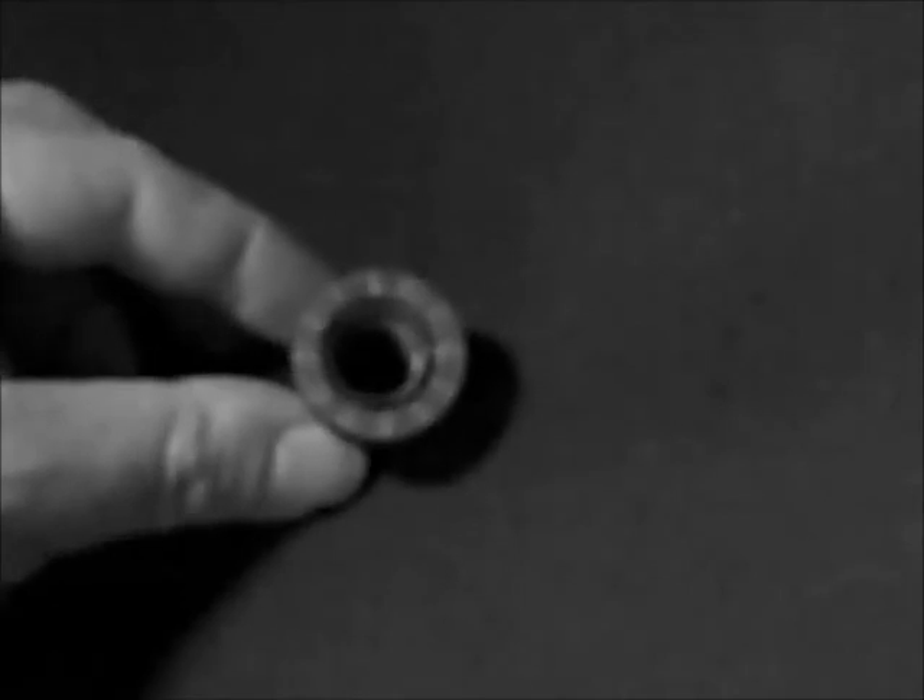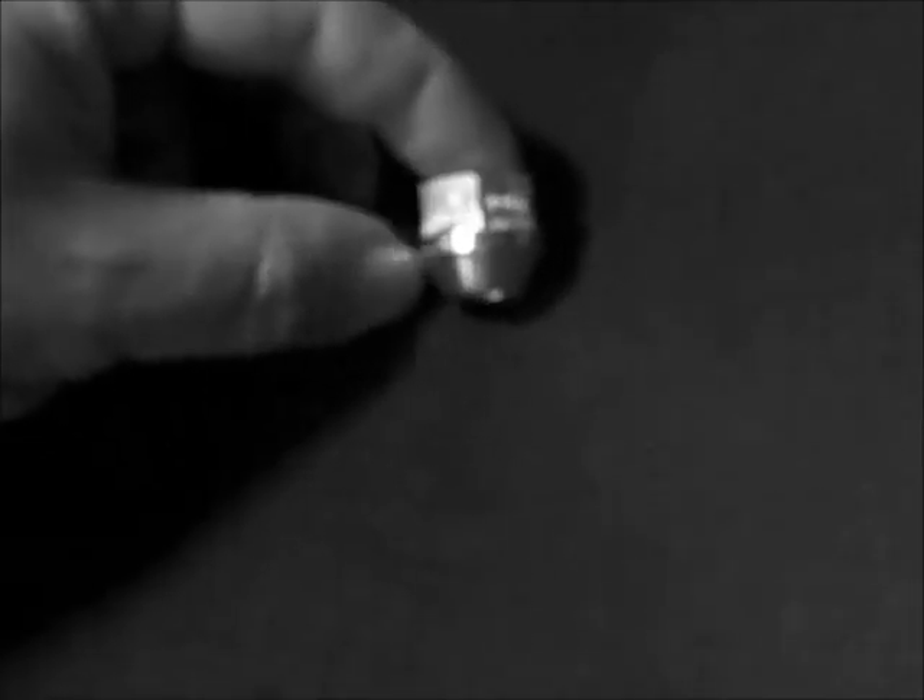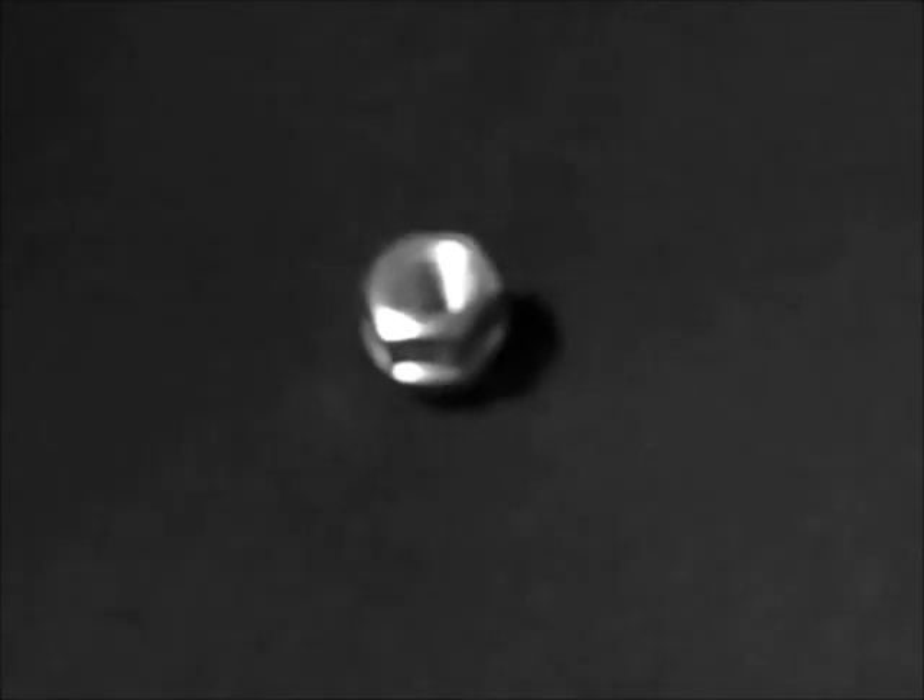Those little star marks around the hole tell me he used the factory lug nut, which is a flat-bottom washer — that is not the proper lug nut for this adapter. It takes a conical seat lug nut that seats on the beveled surface. The required lug nut is an open-ended conical seat with a 60-degree bevel on the bottom. They come in all different sizes and make the wheel adapter lug-centric, centering it to the studs on the vehicle.